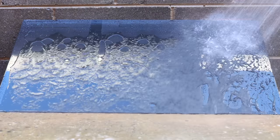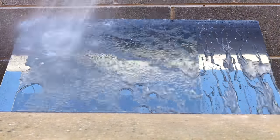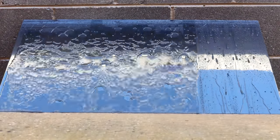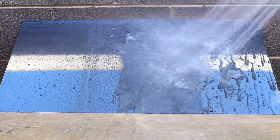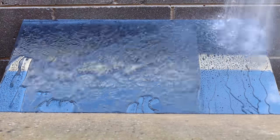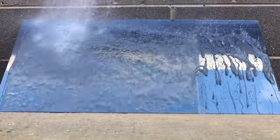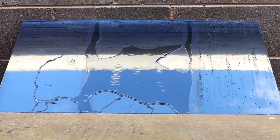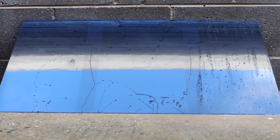Now as you guys continue to watch the footage, what you will hopefully see is that both Meguiars M21 and Jescar Power Lock Plus almost immediately began to break down even after just the very first light chemical hit. I will say that Meguiars did initially resist the chemical a little better than Power Lock Plus, but after a couple more hits with the chemical, they were dead even, and based on all the chemical tests I did between them, they seemed to be almost equally matched every time, but honestly a little disappointing overall in that area.